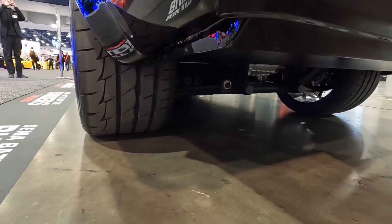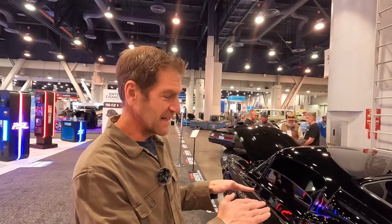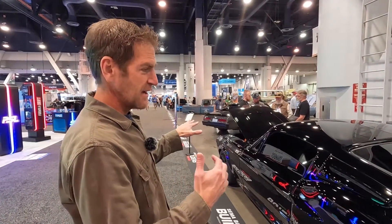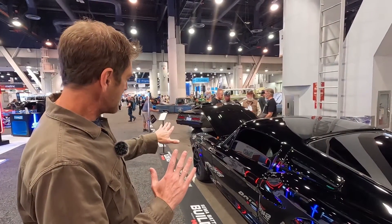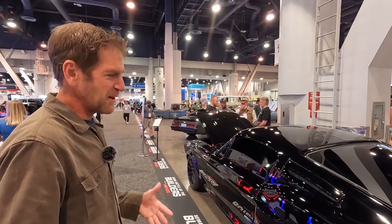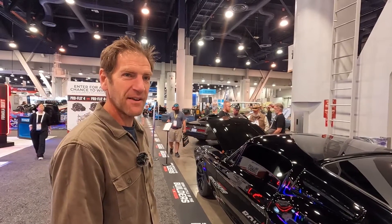Even the 14 inch tires didn't fully solve the problem, so we had to adjust the power curve. With an electric vehicle the power curve is totally programmable — it's not like tuning a gas engine. We defined exactly at what point we want how much torque on the rear wheels and how much on the front. We slowed it down initially on acceleration — heavy on the back to give that thrust feel of a gas car — and then add more to the front so it launches you forward with a rocket ship feel. We're still tuning it.